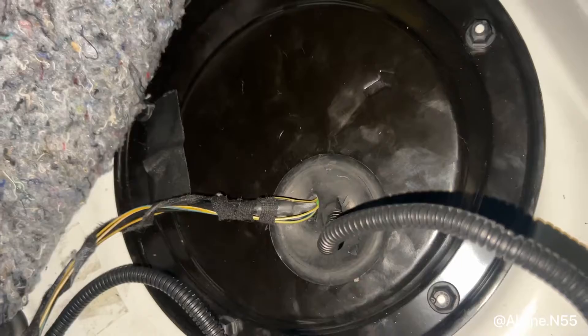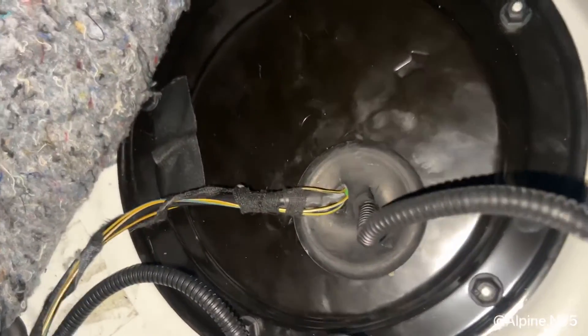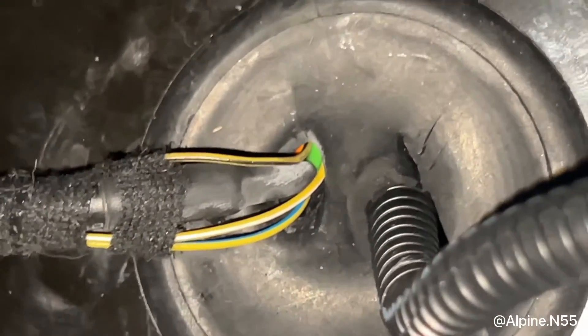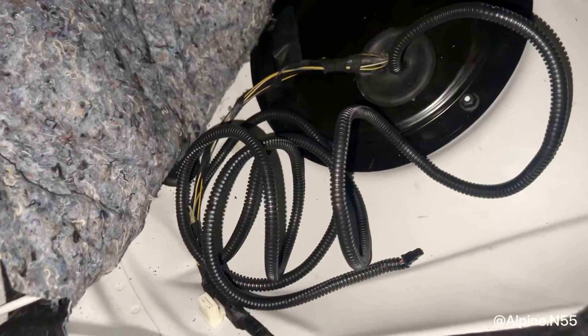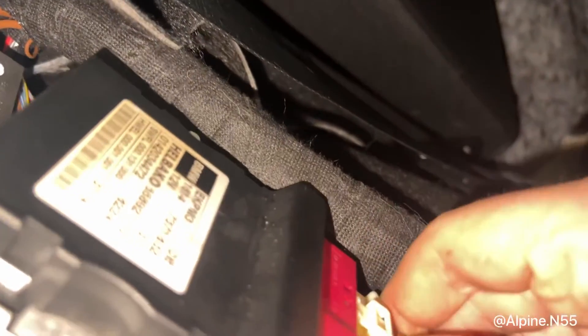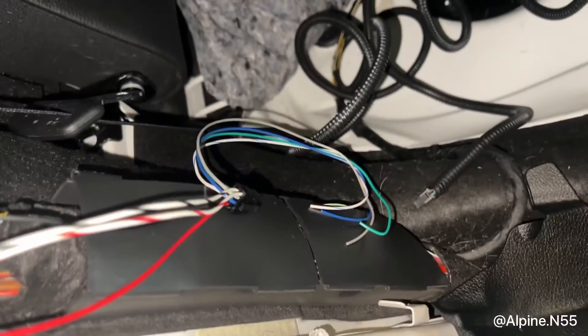I've gone ahead and sealed the top hat. You want to make sure that arrow is pointing upwards towards the passenger seat. I ran the wire through this rubber grommet — I put a hole right there, and it was a bit tough to get through, but it's a tight fit so it'll still be sealed. Once you have this all done, go ahead and grab that wire we wired up earlier, plug it back here into your EKP module. After that, go ahead and run the ethanol content sensor wire behind the seatbelt, and this is where we're going to plug the wires into our actual module.